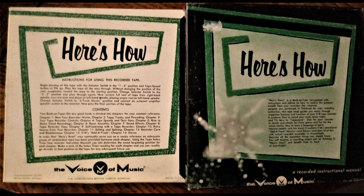Well, I'll remain neutral on that one, Bob, but you've reminded me of a couple more good points for tape storage. Tape should never be stored tightly wound because it creates a strain which might deform the tape. Of course, your VM is adjusted for correct winding, so you won't have to worry about it. However, if you get a reel that seems to be tightly wound, or before you play a tape stored for a long period of time, I'd suggest you rewind it through the recorder and remove any tension before you actually play it.